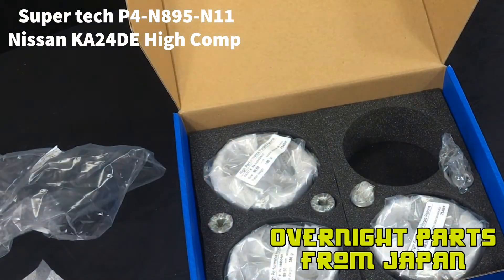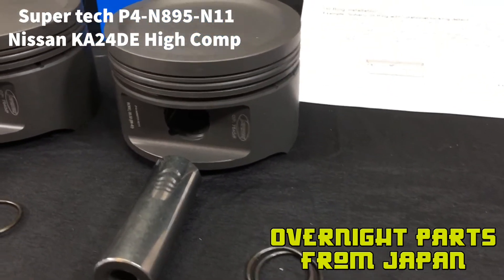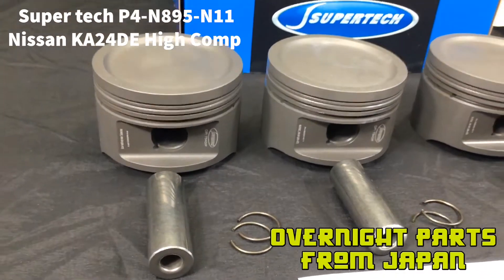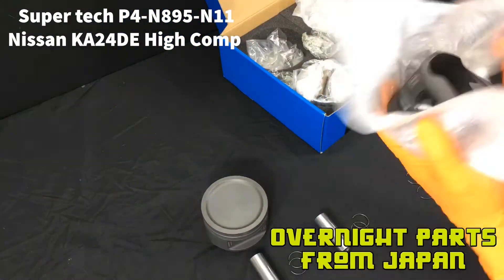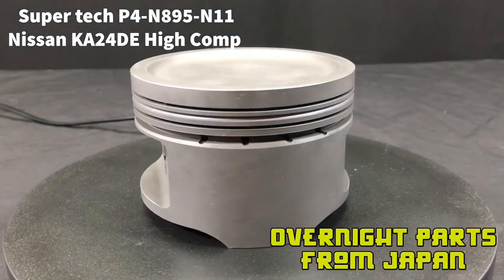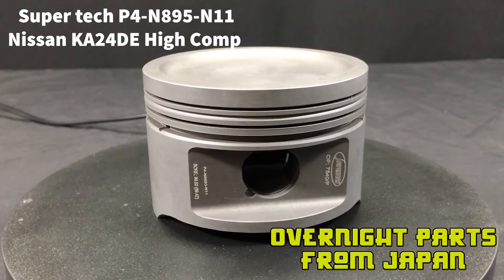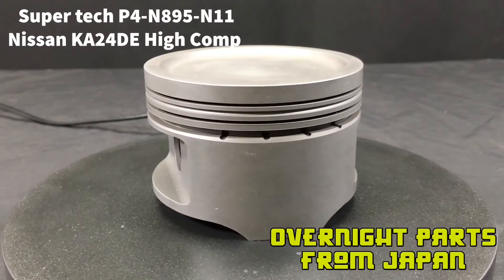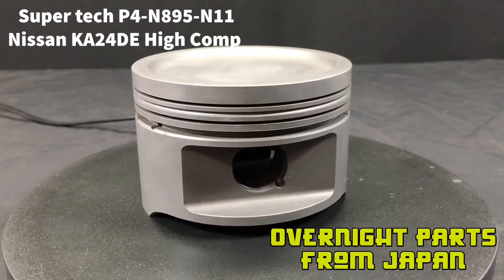Now I'm going to open up all of these pistons for photos so we have a good view from above. This is the clip we used for Instagram and the cover shot — they turned out pretty nice. Very nice, high-quality piston set here. Now I'm going to wrap them back up. Every one of these pistons' stickers was identical. When I list these, I'll probably weigh them individually and write the exact gram or tenth of a gram. Here they are on the turntable. As you can see, the laser engraving is etched into the side of the piston. There is no moly skirt coating, and in the instructions I'll show you, you can subtract four-tenths of a thou from the final bore size for wear.